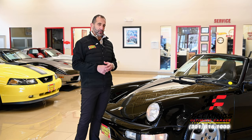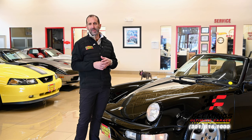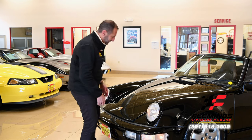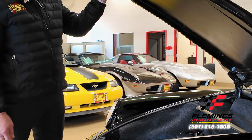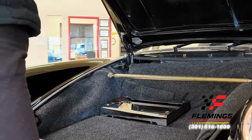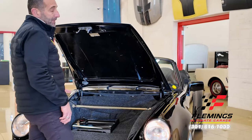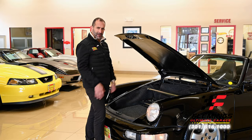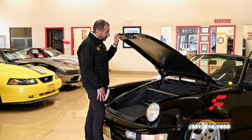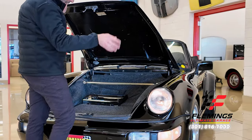While these are considered exotic sports cars, they're also considered the most daily-drivable exotic sports cars built. When we look under here, this is all nicely done — you can put some soft luggage bags in here. This already has an upgraded audio system: there's the amp, subwoofer, speakers, and things like that. This has a strut tower bar here — that's a big piece for keeping the ride stiff and really nice, it eliminates that secondary bump. The battery is up front to put some weight to the front of the car, because the battery can weigh up to 50 pounds — it came from the factory right in there. Nicely done in here — new carpet, new paint, all that good stuff. One thing people ask me is how to close the hood on these cars. You don't slam it because this is aluminum — the hood is super light. When you close it, all you need to do is put your hand on the emblem and close it that way so you don't get handprints on the hood. Just a small tip.